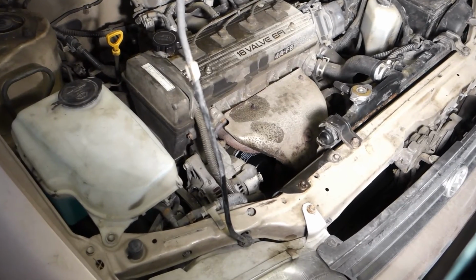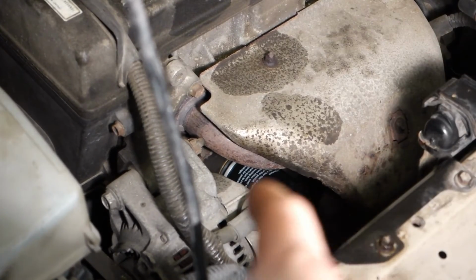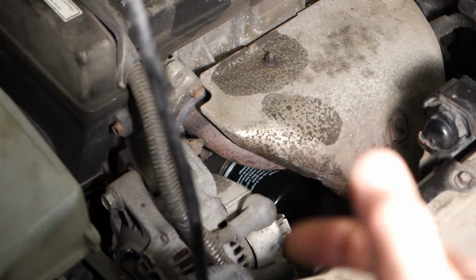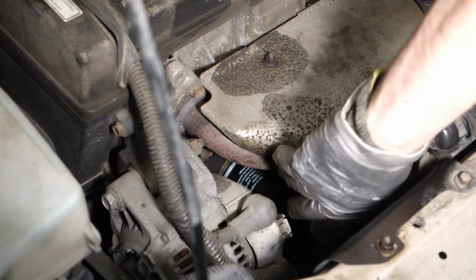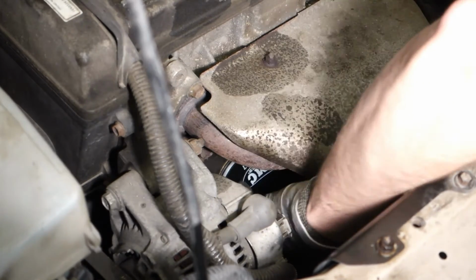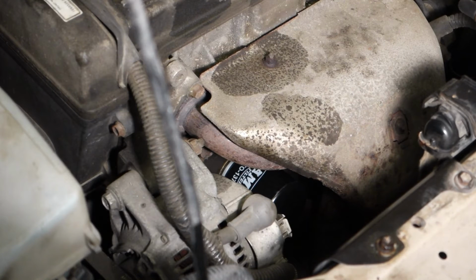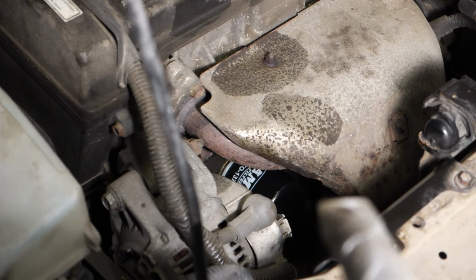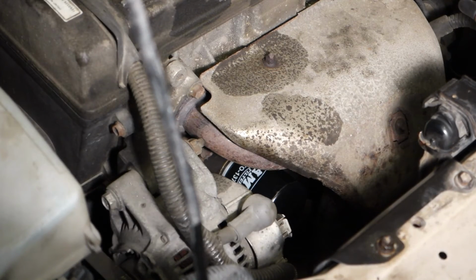Okay, and finally I managed to insert that filter, and now we can see that it is in the center. Next I start to rotate it by hand until this filter and the engine body take contact. Now when it takes contact, there is the second rule that I need to rotate. There is actually very nicely this white AMC logo, and I need to rotate that AMC symbol and filter almost one total turn, and it was actually 75% of a turn, 3 divided by 4 turns.